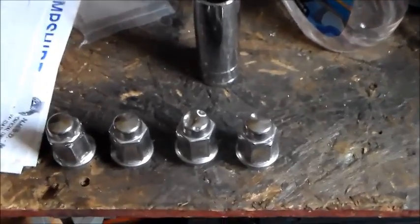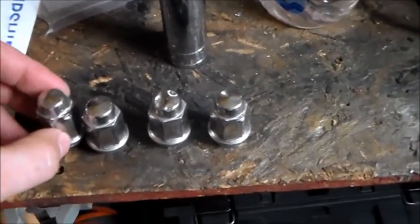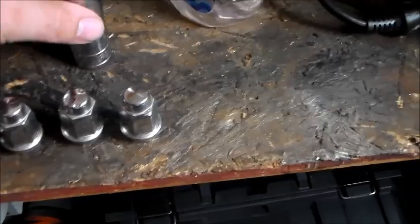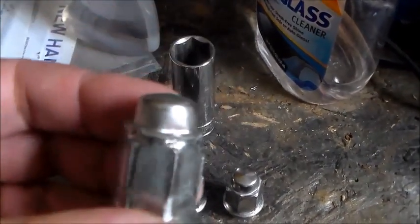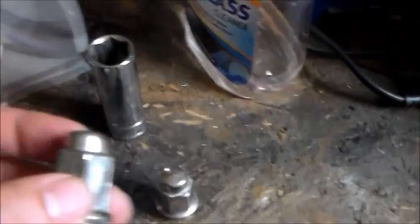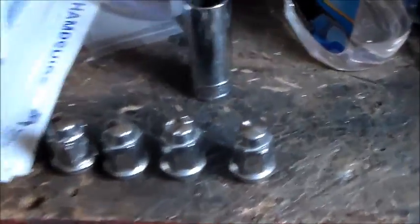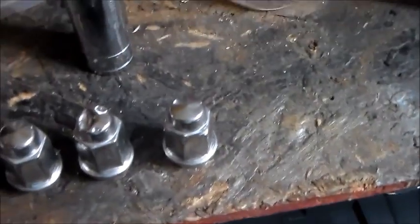The lugs were stuck in the socket and I couldn't figure out what was going on. I did a little checking and found out these are three-quarters — the head on these is only three-quarters. So I did a number on four of them. I tapped on one with a screwdriver to pop it out, which didn't work and did dent it up. So I bought some new Ford lugs from Tasca Ford in Rhode Island. Be warned: use your three-quarters socket, be smart, don't strip out and destroy your lugs.